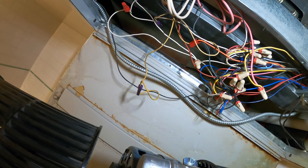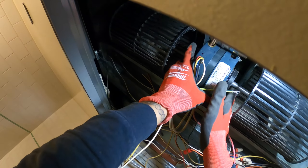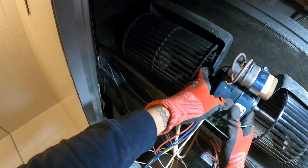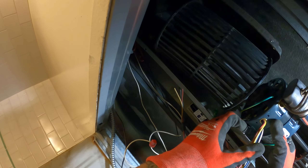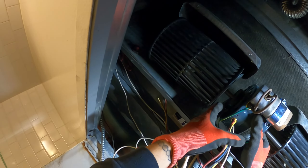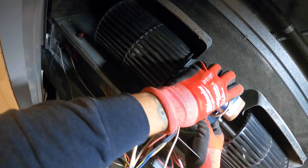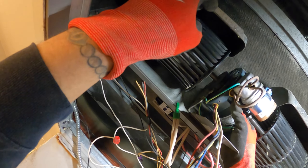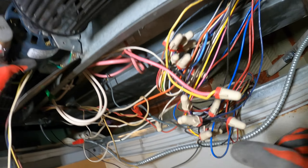This is a five-microfarad capacitor and we have 4.8 microfarads — that's pretty good, I guess we could use it. I put a little bit of tape around the conductors just to be safe because it is a metal cap. Let's fit this onto the mount — I believe it's called a resilient mount. That's it — spin it, no friction. By the way, I put the little clips back in.